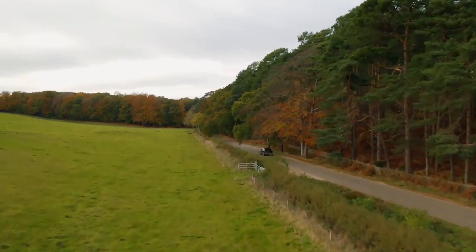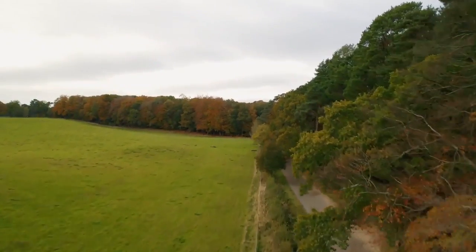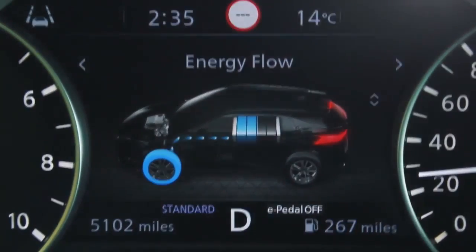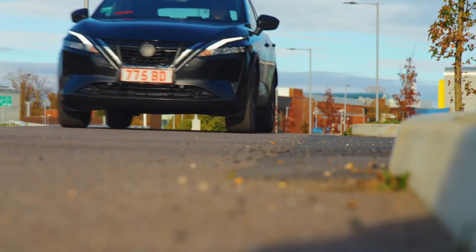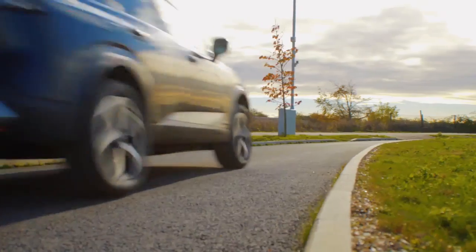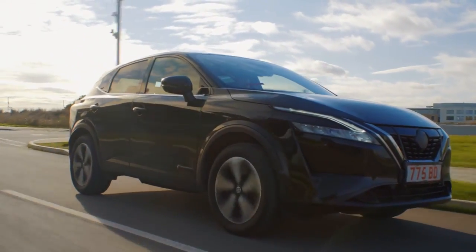We have this large electric motor driving the wheels, and there's another benefit from having this large electric motor: regeneration. As the vehicle is slowing down, we use the electric motor to regenerate some of our kinetic energy and turn it back into electrical energy to store in the battery. So when you lift off the accelerator or push the brake pedal, the electric motor driving the wheels becomes a generator — the wheels turn the electric motor, that generates electricity and that goes back to the battery, so we can use that energy again later to re-accelerate the vehicle. This really brings strong efficiency to ePower.